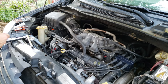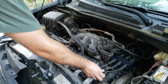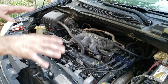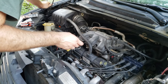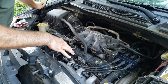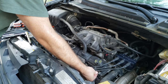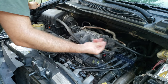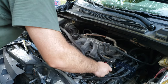The ones that were on here actually were numbered — they're Mopar wires so they have the numbers on them as you can see. I wanted to go ahead and do that ahead of time so I'd have everything numbered and could put it back in the right place. Now I'm going to go ahead and do the fronts, taking things off in bulk since I know where the cylinder positions are and I'll know where to put it back.